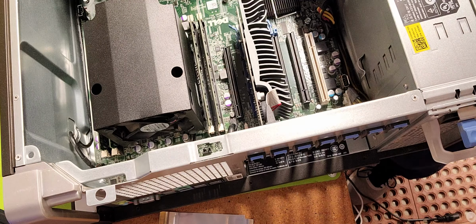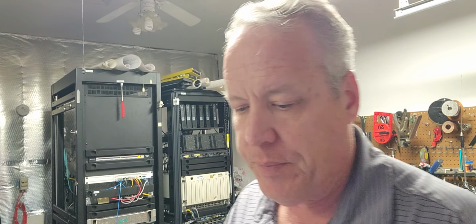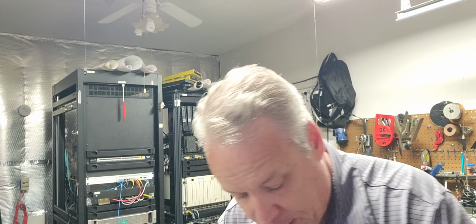Now, one important detail that needs to be understood here is that I showed you about the airflow on this, right? And the uniform airflow in the back, that checkered look, like you can see here. See the checkered pattern. That's important because that produces what we call an even flow. Now, the CPU has its own fan which pumps it out directly. That's good. It's not what's called an indirect fan setup, where you have a fan on the front of the chassis and then it's got plastics to guide the airflows through certain areas like RAM and CPU and all that. These areas actually are fairly independent. They're actually able to do exactly what they need to do, and that means that heat is well managed. Very important when it comes to Xeons specifically. So this chassis is actually very efficient in its design.